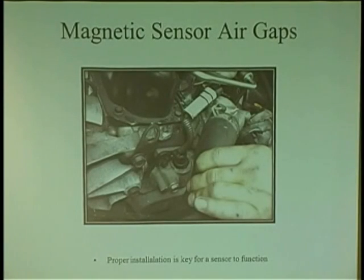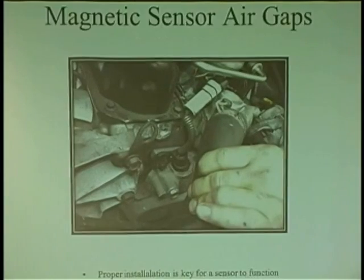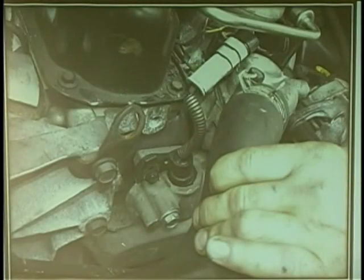And here's another thing too is, we put in a sensor, a typical sensor. We'll put it in place. Okay? Brand new sensor. I test the sensor. It don't work. It's brand new. It's got 3 wires: 5 volts reference power, reference ground, and reference voltage. The voltage line has to be toggled to ground. I put my meter on it, nothing's happened to it.